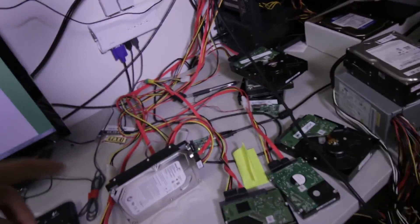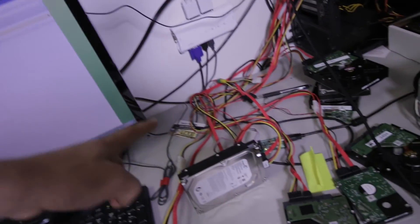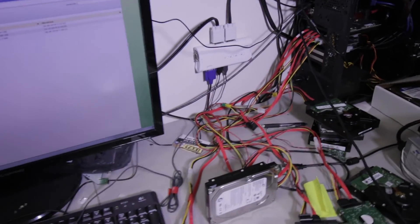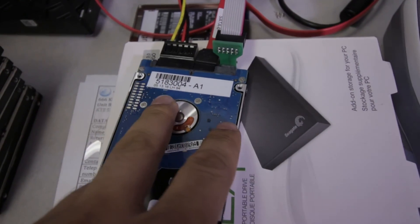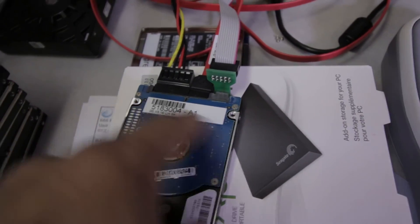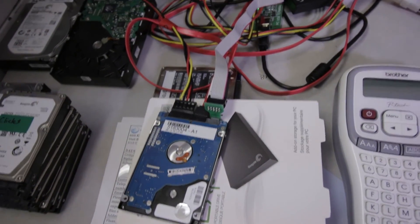So the results from yesterday's work — we got the two-terabyte Seagate partially recovered, about 85 percent of the data, after the head swap. We were able to run it on five out of six heads and get at least a partial image out of there. A lot of good recovered data on that case. This is the case I'm really happy about — the one that was at Seagate OnTrack previously, based on that label. We got it fully recovered after the head swap.